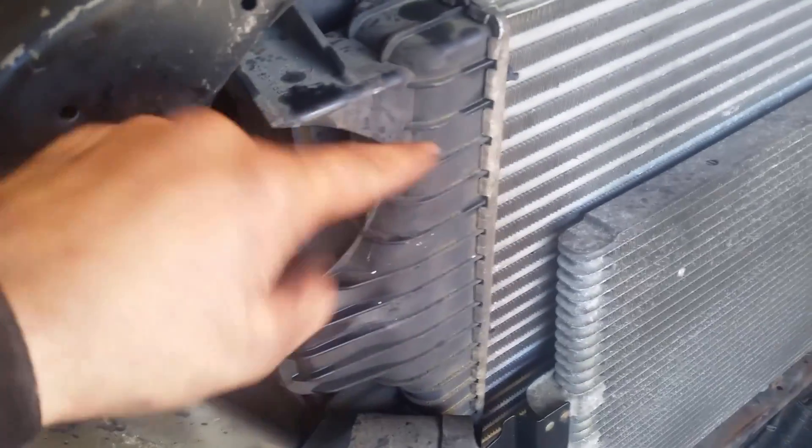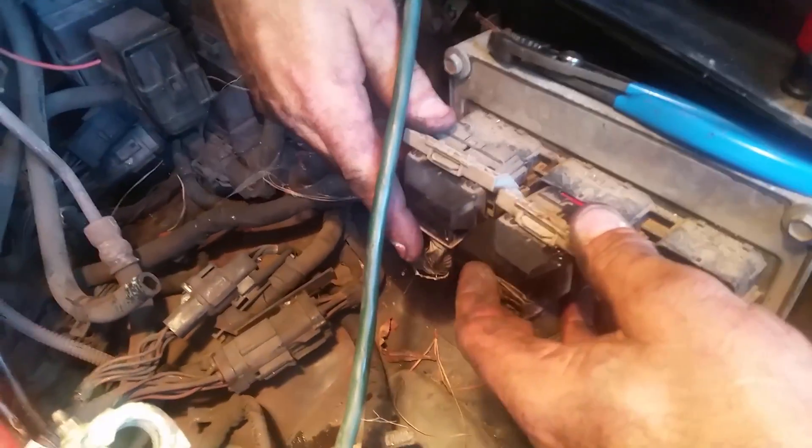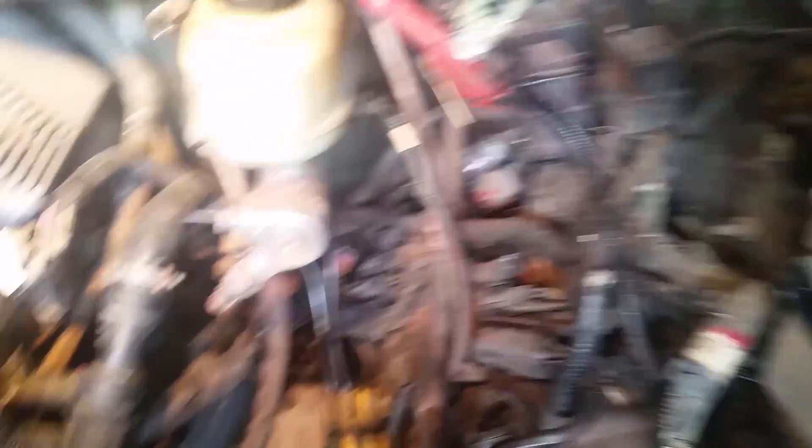Here are the AC lines — you have to remove these two on the condenser. Make sure you drain your Freon properly; we just undid the lines but that's not recommended. Here are the electrical connectors on the driver's side — there are three that go into the computer and a whole bunch of electrical connectors over there; take all those out. In this corner is where your power steering reservoir is — remove all those hoses and slide the reservoir out; there's a little bracket to remove as well. Remove three of the brake lines, and down in here we have a steering shaft — there's going to be a bolt on top that holds it on. Remove those two lines on top of the steering rack.